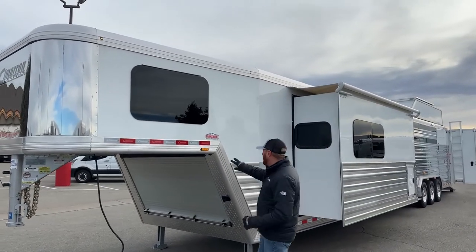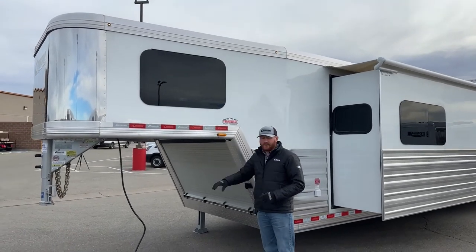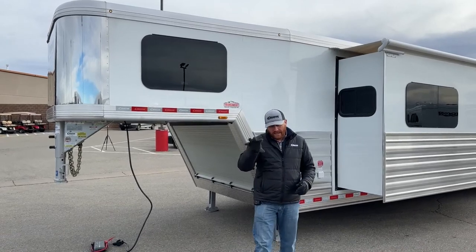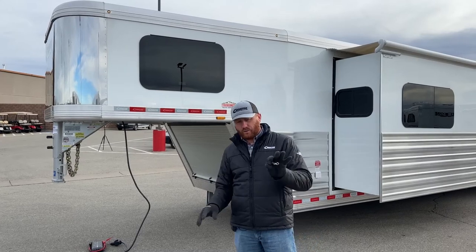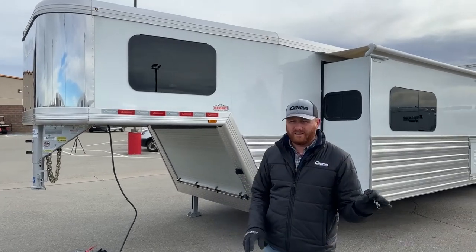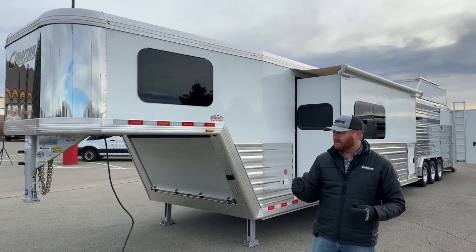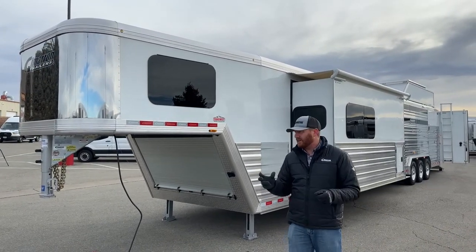We've gone to the pulsating light, so it flashes, so it just catches your eye a little bit more. We used to do this light, one big solid, but we wanted it to be foolproof, just, hey, this thing's on. Again, you need to be aware of it. You need to be conscious of where this thing lives so it doesn't get bumped. Because if this gets bumped and you're rolling 75, 80 miles an hour down the road and you hit the brakes hard with these big electric over hydraulic brakes, there's no resistance on that. So it can really flat spot a tire really quickly.